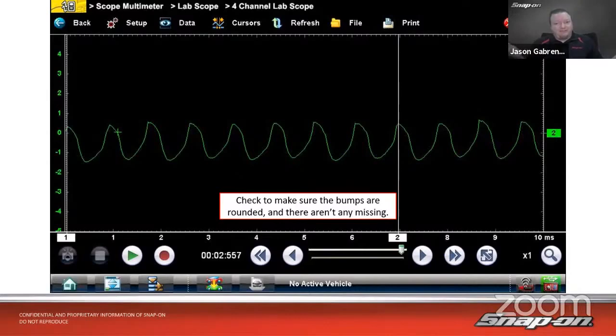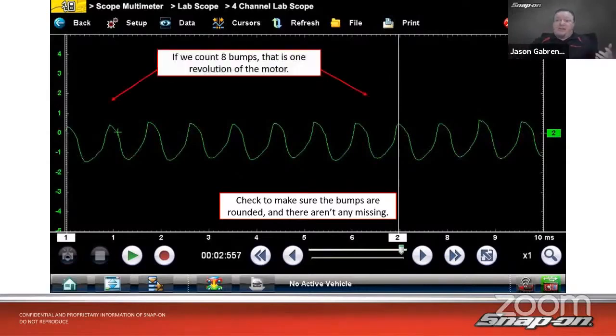But it's like playing roulette, hoping it doesn't land on the bad segment, right? So we want to measure that and check. So if you suspect you have that problem on a vehicle with a customer complaint of an intermittent no start, that may be the cause. So you can always go check it out with that current probe and make sure that it's working.